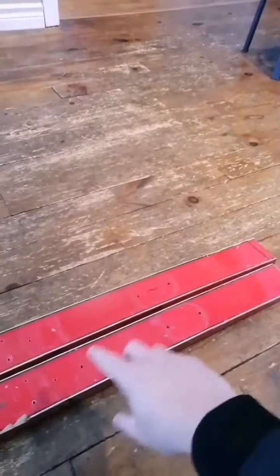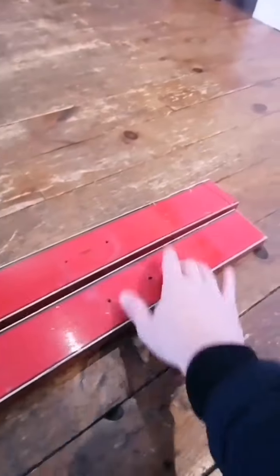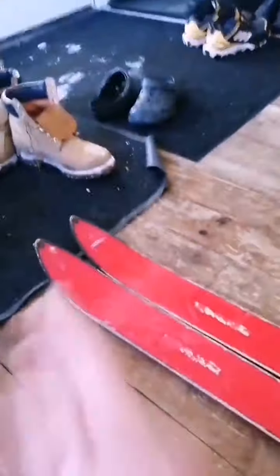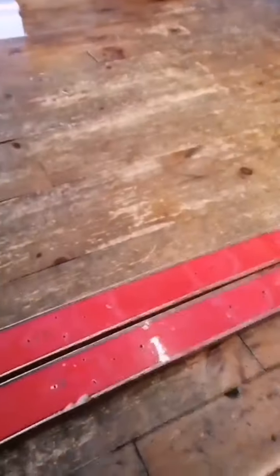Picked up a 2x4 and a 2x6. So I'm gonna cut four 1 foot 2x6 chunks that will go one on each side of the back, and then the other ones will go just a bit further up on the skis. Trying to keep everything to the back. That way, when I'm towing, I'll keep those skis up on top of the snow, and try to make it as easy as possible.